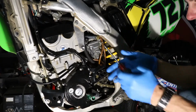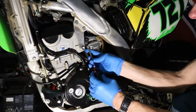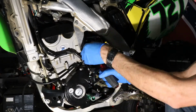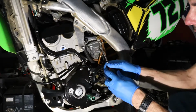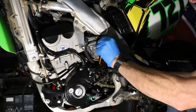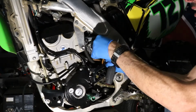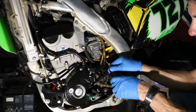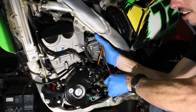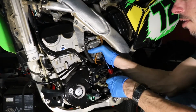And since I had these screws off, I did not torque them intentionally. And so I'm able to drop the bowl screws without using an impact driver. I let these loose because I figured I'd have to rejet this, because this particular customer runs this bike year round, and he runs it in all different locations and changing altitudes. So I have a good variety of jets laying around just to be able to rejet it when I need to on the fly.